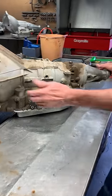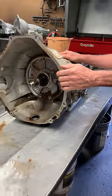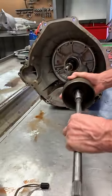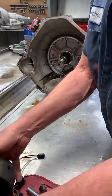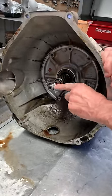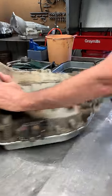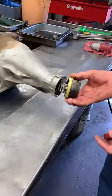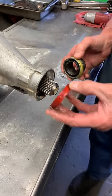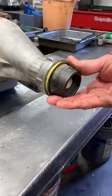They did a lot of changes with this transmission. The first design was a mechanical lockup — a direct drive lockup. The third gear shaft splined into the torque converter and made it a direct drive when it went into third gear. This version has a single shaft coming out that locks the torque converter up, computer controlled. Also, the 4R70W has a yellow seal and it's bigger, where the AODE has a much smaller seal. That's another way to identify them.